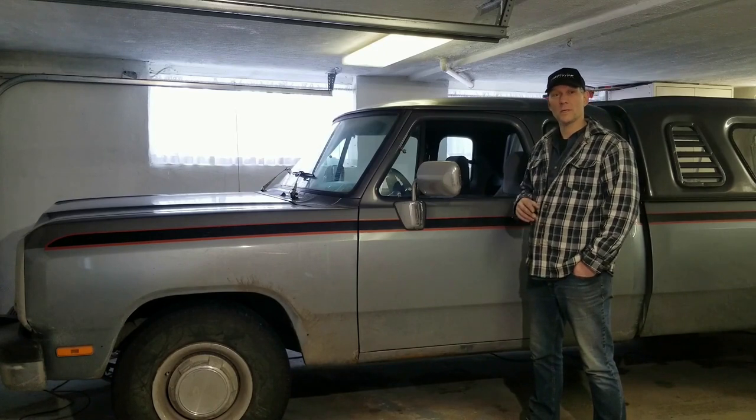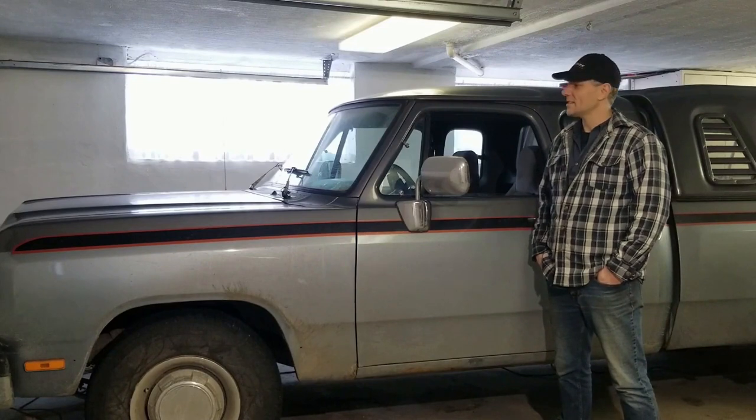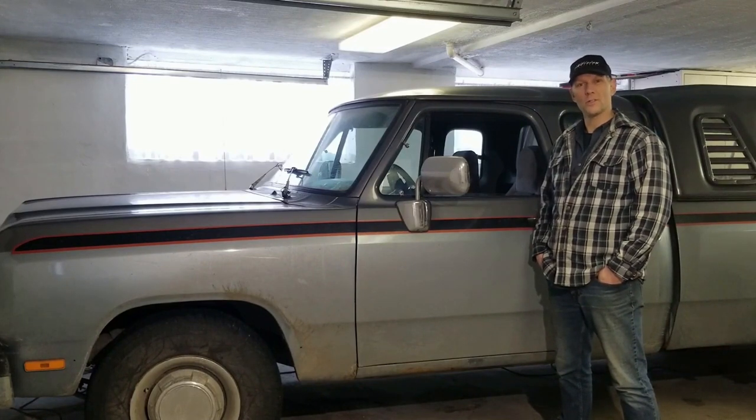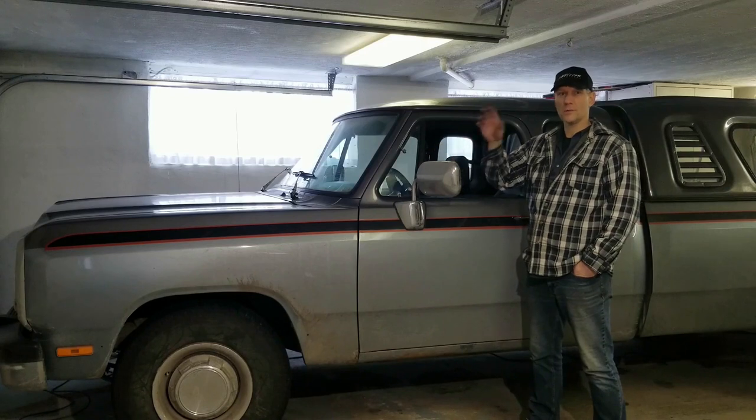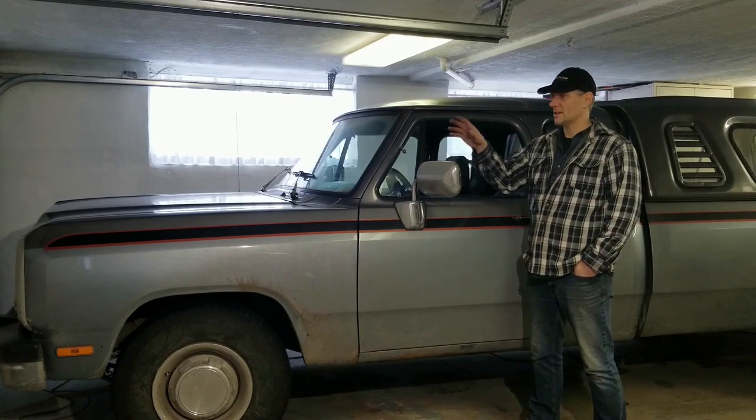In the meantime, we were talking to some people and they told us that this truck had a PCM in it — a computer, a black box. Go figure. This is a 93 Dodge, and the first-gen Dodges had a computer down in the front wheel well. For whatever reason, moisture got into it and it died. And when that goes, you lose a whole load of stuff that makes this thing undriveable.